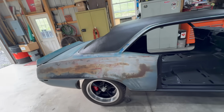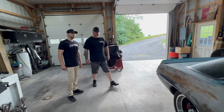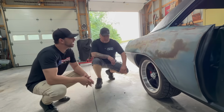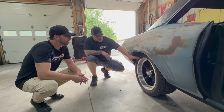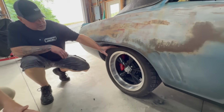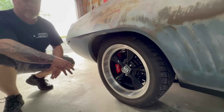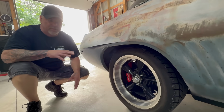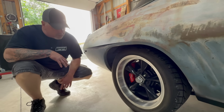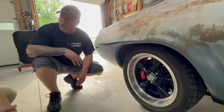Okay. One thing right now, you have the 18-inch wheels on the back here, and I know we had talked about putting 20s, if I'm not mistaken, on the back. Yep. So that's going to actually add a little more height here on your rim. So it's going to give you another appearance of feeling that wheel well in, and it's going to give you a little bit lower stance. But yes, we still can go down. There's a little bit more adjustment there, and we can tweak everything with the coilovers also.